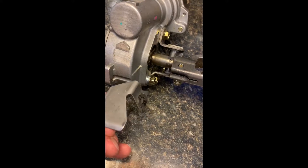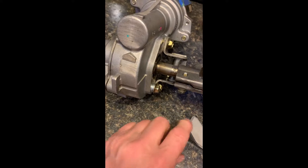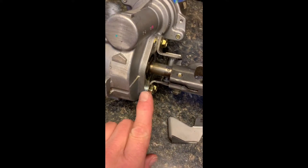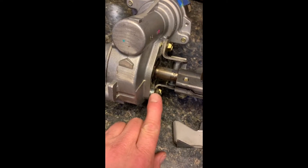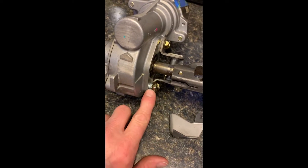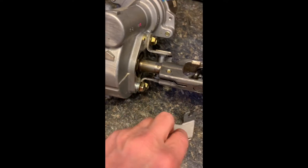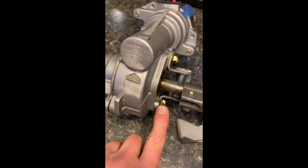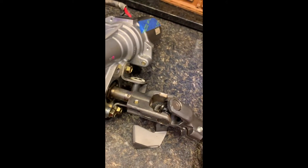Something to note: this metal bracket was mounted behind this bolt. You're not going to need this bracket, so if you reinsert this bolt - to keep debris out of the unit because it's open to the moving mechanisms - you need to space it out with a couple of thick washers at least as thick as that mounting surface from this plate. Otherwise that bolt will strike the moving components and prevent the shaft from turning.